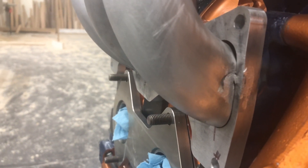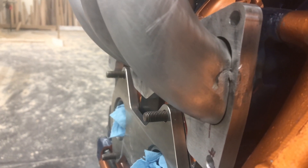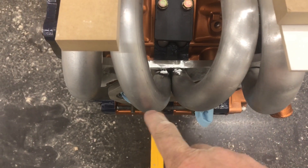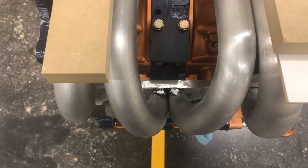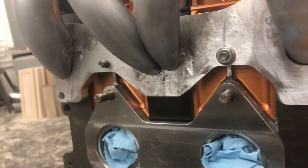There are two disadvantages. One is now I don't have enough to cover the top part of the port, so my welder is going to have to do a heavy fillet weld there for me, and then I can port it on the inside to get a nice transition. The other problem is I had a dream of having these be lined up, but this one droops in and this one sticks out. That didn't work quite like I had planned. The middle ones here, though, worked great — they fit in on the oval shaped port perfectly and smashed in the middle.